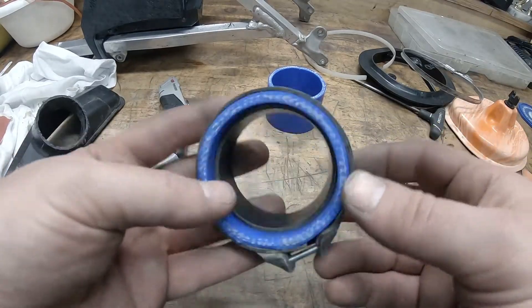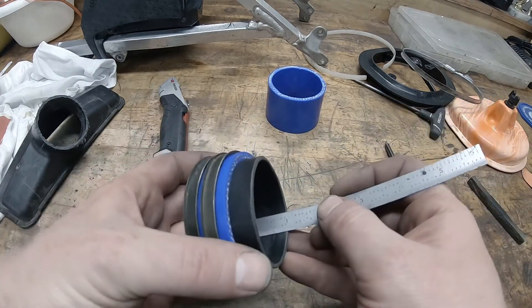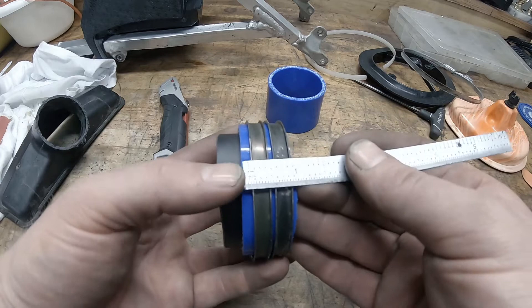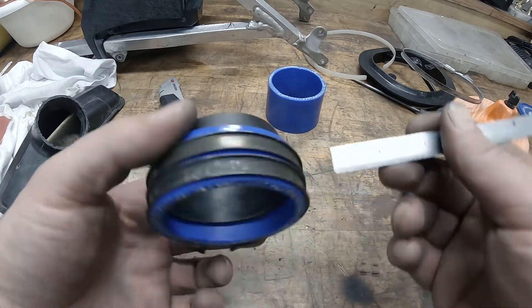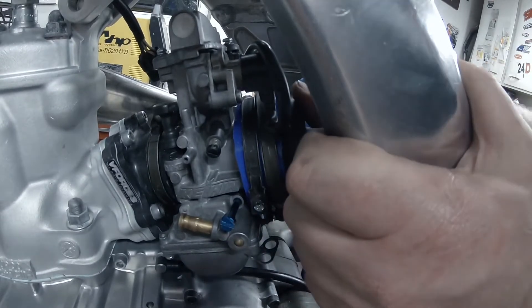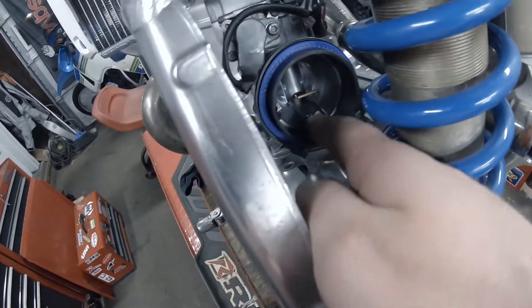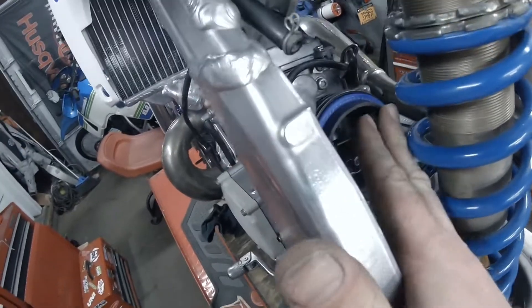So this is basically the coupler I came up with — we're all at one inch. I marked a black mark on top because the bottom is actually 0.9 inches, and going in it's 0.4, so that's actually going to be at the low spot where the float bowl is. Coupler in — you can see it fits right on the face of the carb there all the way around. There's enough for the ports here to get all the air they need. Maybe a little bit of turbulence — I could possibly file them down, but I'm honestly not too worried about it.